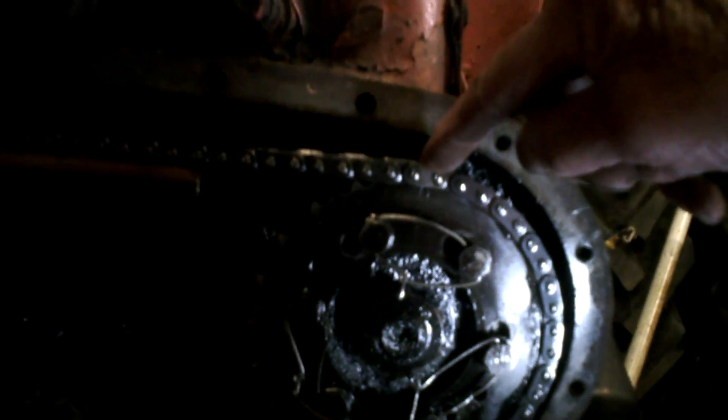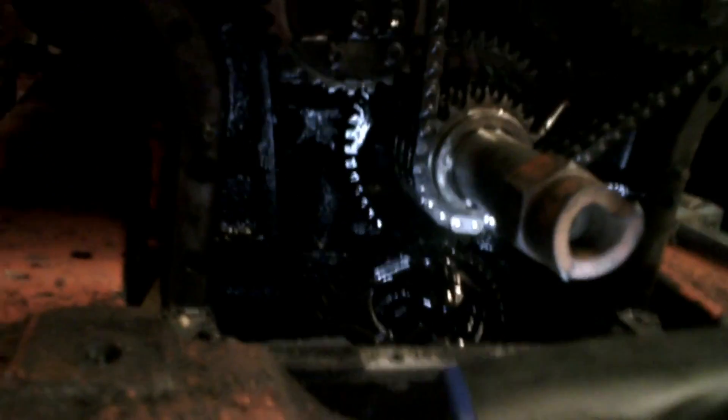We have chains and pulleys on cars that I've done, but you know what I mean. On this sprocket, it's exactly the same — that's got a T mark on a bright link lined up with that. Also, on the bottom sprocket, the bright link with a T on it is lined up with the keyway. So that's how you time a 3.4 DM4 Nuffield engine, and as you can see, everything in here is in very good condition.